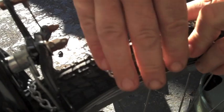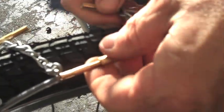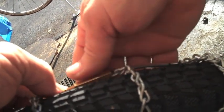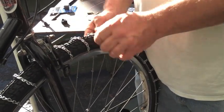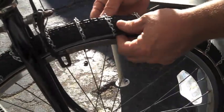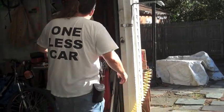The nice part about the snow chains, as opposed to like a studded tire, is that you can take them on and take them off — relatively easily. Now we're cooking. I want to get the other one going at the same speed. Now we're going to cinch them up as tight as we possibly can. So does everybody understand — I want to make sure the gook doesn't get jammed into the threads. Wheel spins this way; we want all of the stuff to go sliding right off. Let's make sure our chain is nice and straight and even on the whole shooting match. Looks good — let me get some air going in there.